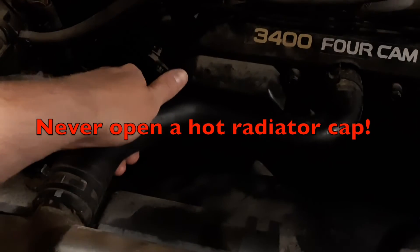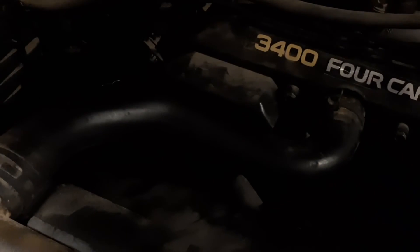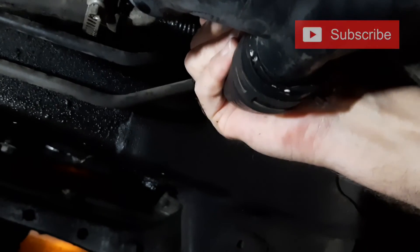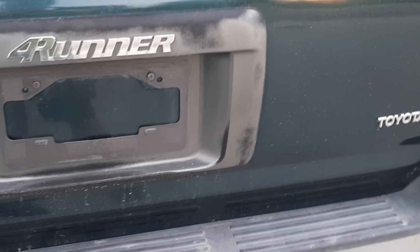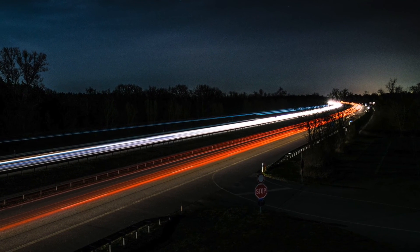The last thing I like to do is carefully feel the hose, keeping my hand away from the fan. Once the thermostat opens up, both hoses should be hot — one hotter than the other. This one's hot. The one down here was cold a minute ago and it is now warm, so that's good. You want to feel movement — you want to feel that water moving through it. So that's going to wrap this one up guys. Please leave comments or any concerns and questions in the comment box. I appreciate you watching. Please consider subbing if this helped and liking the video, and I'll see you next time.